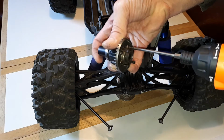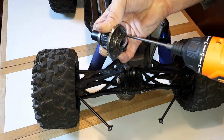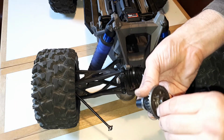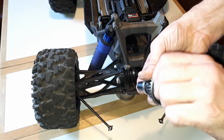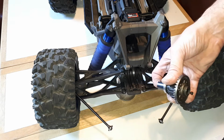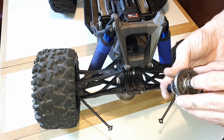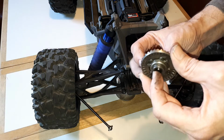But when you're doing up your screws, if you're new to it, you've just got to remember, they're going into plastic, and you really do not have to do them tight. It just has to be done up, just in as far as it needs to go, and that's it. Because if you put a little bit more extra pressure on, that puts stress on the threads and can rip them off over time, or you can just strip the threads while trying to put that on. And there we go, you can remove that.